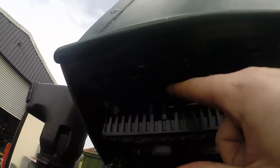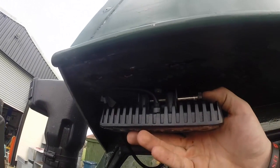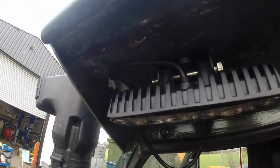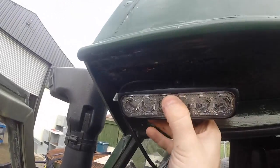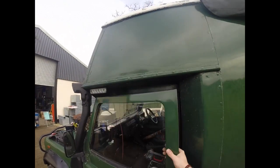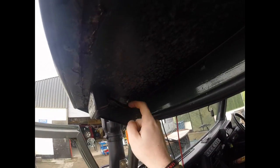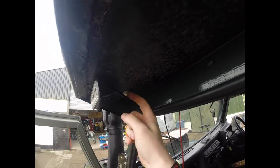So as you can see here, I've just mounted the bracket on. I need more hands for this — we're just putting the bolt through now. That goes on through there. Washer on this side, nut on, and we'll poke the cable up through the top. We've got the work light — so that's mounted now. It clears the door. I've not pulled it up tight; we've got a little grommet in here. You always leave a little bit of a loop — so if any water hits it, it drips off there rather than going back up into the fitting. You always leave a drip loop.